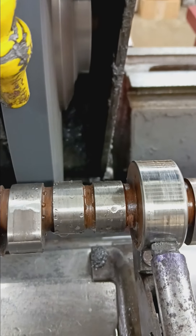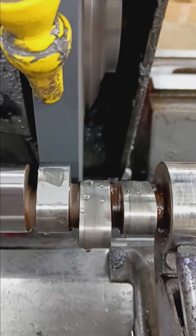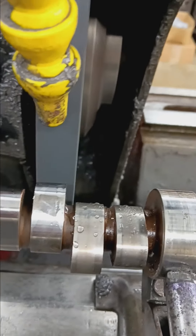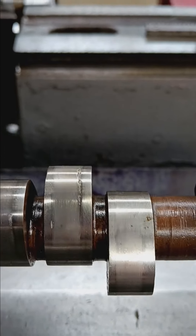And then all this area here is low, probably from lofting — as the valve train is out of control as it comes across the nose. But most every time, that's the way it's going to be when we regrind these cams. You look at them and you won't even think there's really any wear.